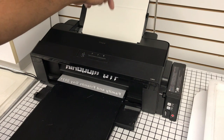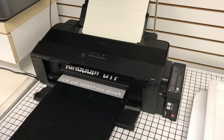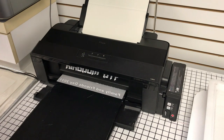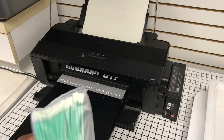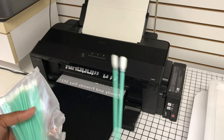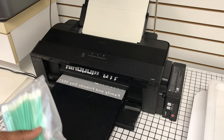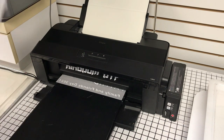the rubber roller that you might want to clean with an alcohol swab, or if you don't have the little prep pads, you can dip one of the foam swabs. You don't have to use these. They are in the link in the description, but dip it in some alcohol and you'll rub that roller clean. All right, bear with me.